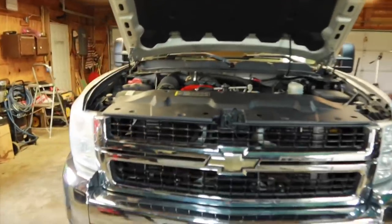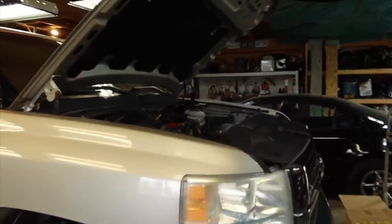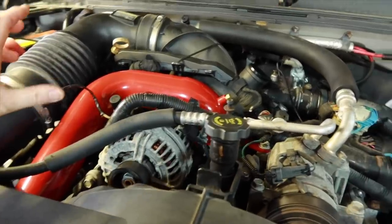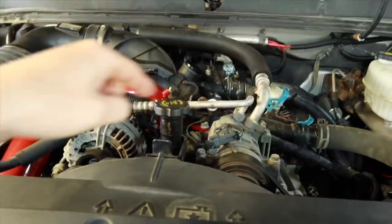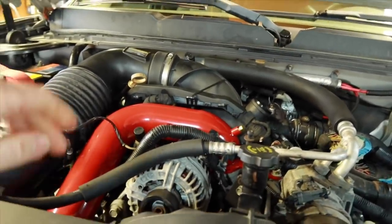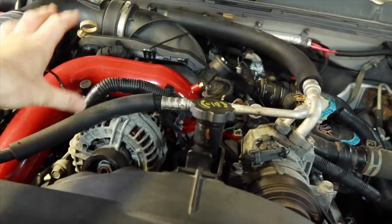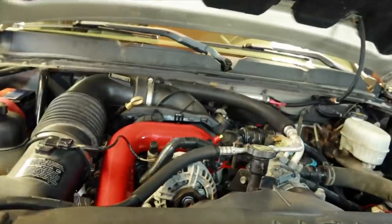I have Melanie, my wife, Mrs. Truckmaster, on the YouTube channel today. We're going to be working together. Just to get you guys up to speed, this is a 2007.5 LMM 6.6 liter Silverado Duramax diesel. I have the HSP bundle kit, which is basically the cold side charge pipe with that little bracket. It's connected — grab this pipe, it's going nowhere. You don't want these pipes to wiggle because you'll blow an O-ring right there in the valley on that Y-bridge.